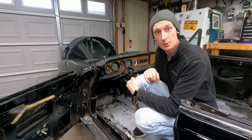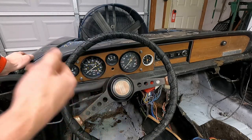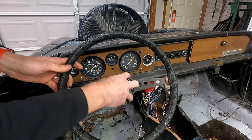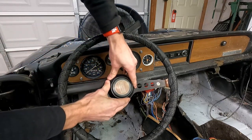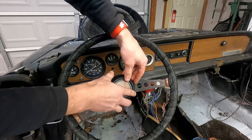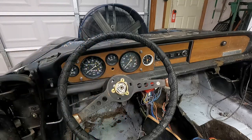The first thing we're going to need to do is remove your steering wheel. I put it back on really quick just to show you, even though mine was already off. This outer plastic cast here - you can squeeze it and work it back and forth; it might take two hands. It's got three little tabs and it should come straight out when you squeeze it. Be careful because it's got a spring - the center cap and the spring - and that'll reveal the nut.